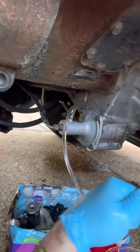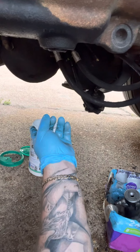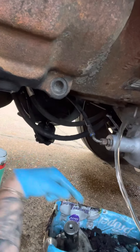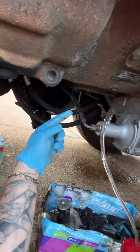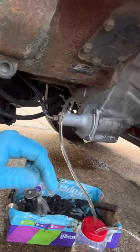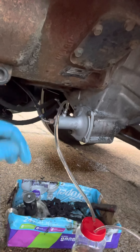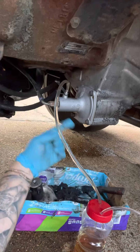You're gonna slowly pump your clutch. Take off your side fairing and you can look through underneath the batteries — set this where you can see it. Make sure you keep filling up the reservoir up top. Slowly pump your clutch and your clutch will get hard as shit, harder than you've ever felt it before.